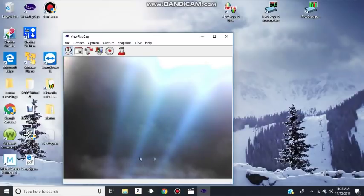Okay, so at the very bottom, you can see the huge carbon deposits right on top of the intake valve. Here's a stem, and as you can see, more deposits here as well. The car has 130,000 miles on it. I wish I could have a better picture, but this is the best I can do. This is the valve seat here, so that's still okay. Now let's go back to the other one.